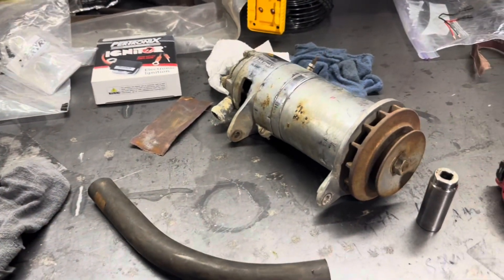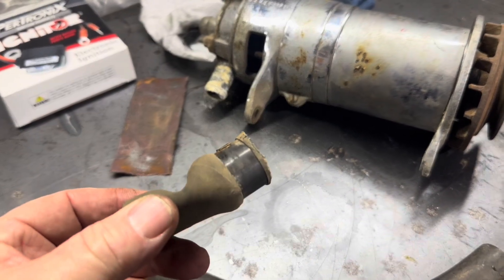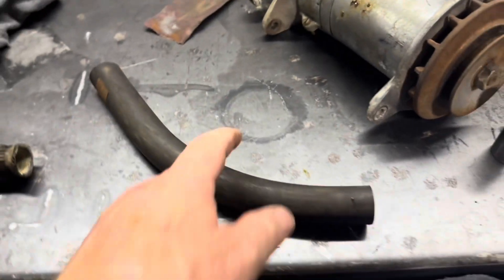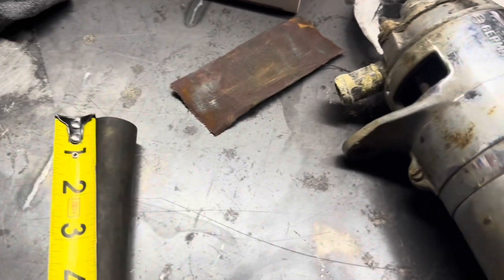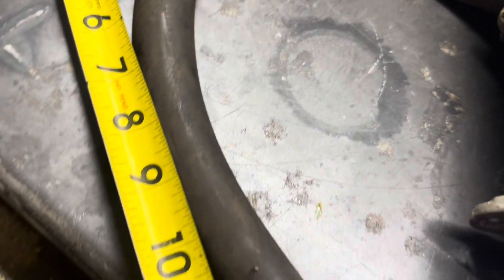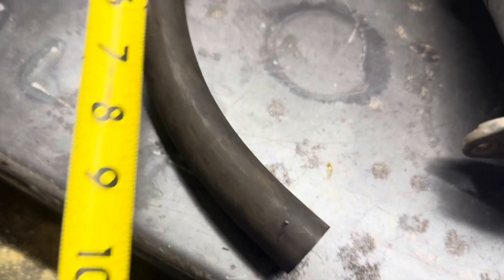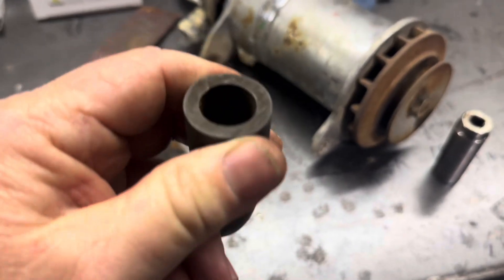A little more input on the bullnose stuff. The hose that runs from the bottom of the water pump to the water outlet underneath the exhaust manifold shouldn't exceed 11 inches in length. I've got a picture and I'll try to include that. This is a factory hose here, and if I check the factory hose, it's just a tiny bit over 11 inches — it's like 11 and a quarter. And this is a really heavy duty hose, so it's not going to collapse on you. That's the purpose of it.